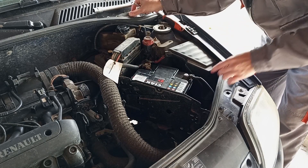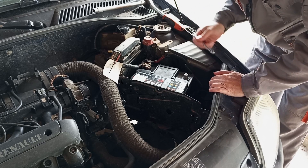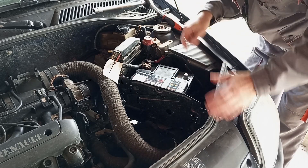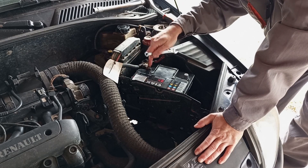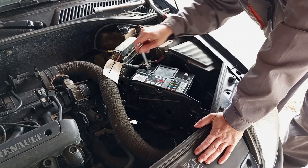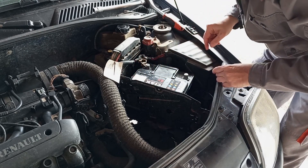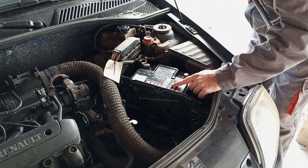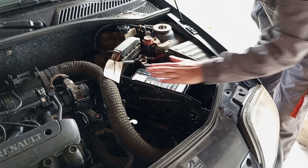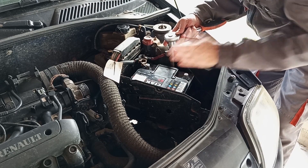When taking off the battery, always take the minus battery clamp off first and tuck it aside, then take off the plus terminal. Why minus first? If you were to touch the metal with the wrench, you could cause a big short circuit — and that's dangerous. So always take off the minus battery clamp first. Note that on most batteries there is a battery holder — a piece of metal held by a screw or nut — that keeps the battery in place so it doesn't slide while you're driving. When taking it out, search for the battery holder first; don't just try to pull the battery out by force.